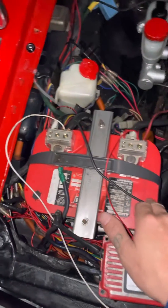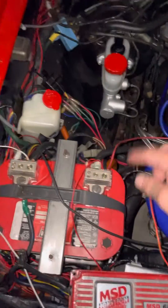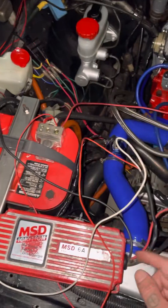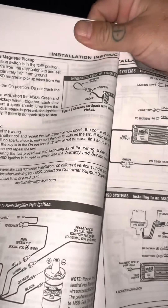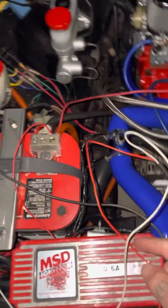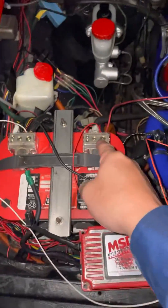This thick black wire is the ground to the battery. Then this thick red wire is the positive of the battery. This white one coming out of the box, I got it connected to the negative — I believe the white one is to the ignition amplifier, so that one goes to the negative. Then the thin red wire, I got it hooked onto a switch, then back to the positive side of the battery.